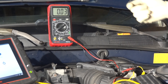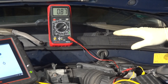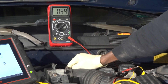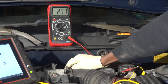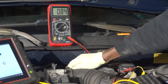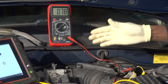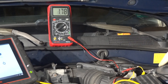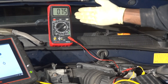Now let's start the engine and look at this signal. With the engine idling, we're reading about 0.84 to 0.85 volts. As I increase the engine speed, this voltage should also increase. As you can see, our voltage is increasing nicely and smoothly — it's not jumping up and down. That's what we want to see. This is a good working mass airflow sensor. It increases, then comes back to about 0.75 volts at idle.